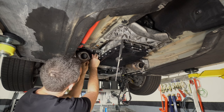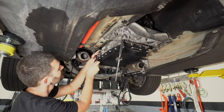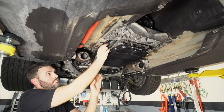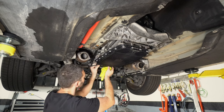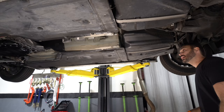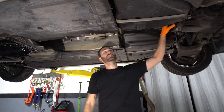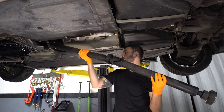Let's get these up. Now we'll remount the shifter cable and reconnect all of the harnesses and sensors. All right, now let's get the driveshaft in. We've got the front bolt, the rear bolt, and then a center support right here. Before I took it off I marked it so it would be in line with where it was before — the white mark here corresponds to a mark up here.